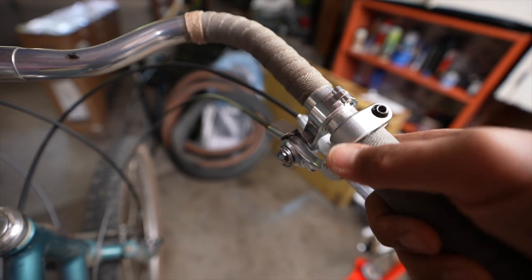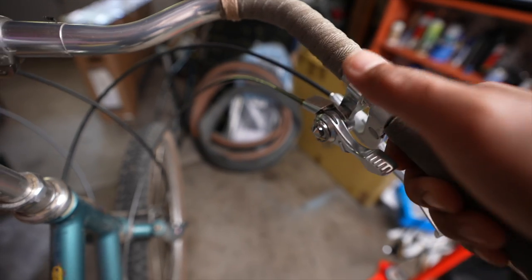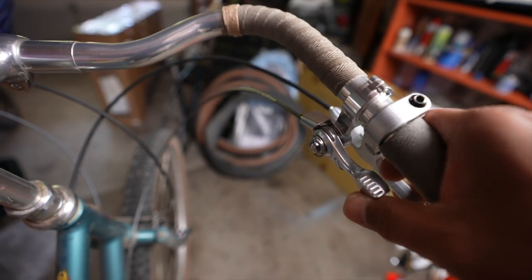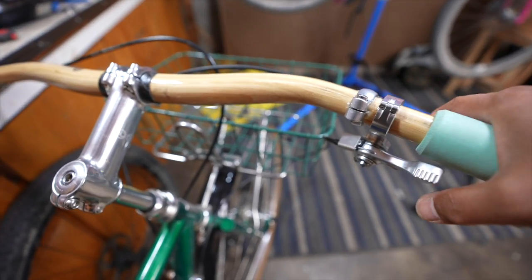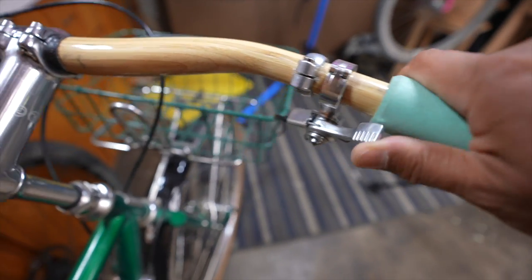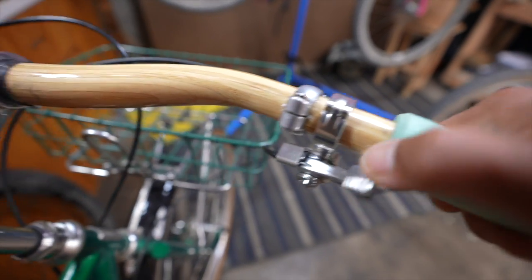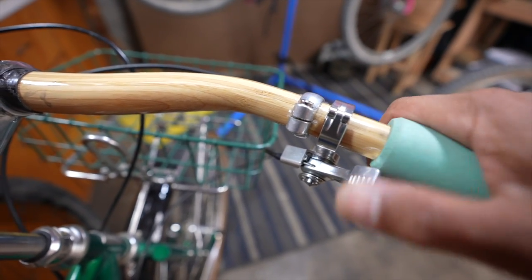It looks a little confusing at first but in actual use it's really smooth, and once you get used to it I much prefer it over pushing with my thumb up top — rather than pushing down and having total control over everything. This is my Velo Orange polyvalent and I've also applied the same thing with a Rivendell shifter. Super comfy position — it basically mimics what you would get with a modern trigger shifter mounted below.